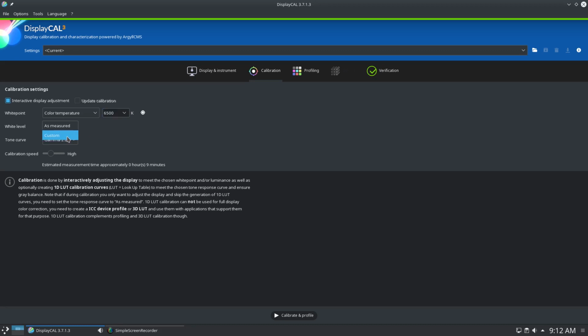White level, we're also going to change. Now, this is the brightness of your whites, and I'll leave it here at 120, and I'm also going to keep my tone curve at gamma 2.2 like I showed you before. I will leave a link in the description that explains why we use the gamma 2.2 tone curve. I also like to take my calibration speed down to medium.